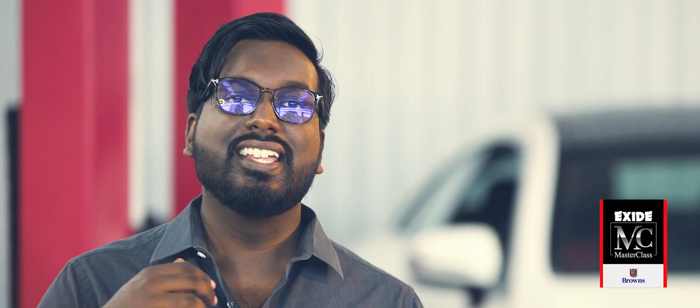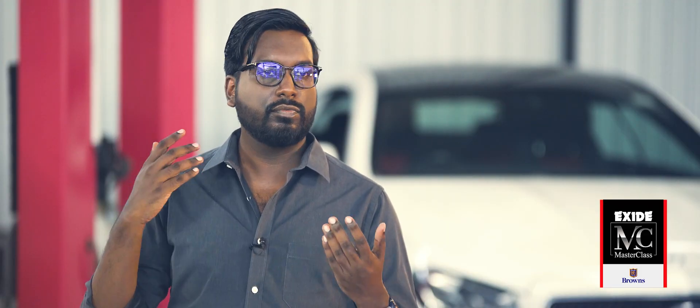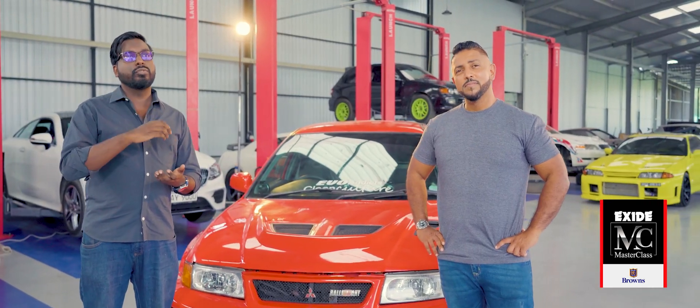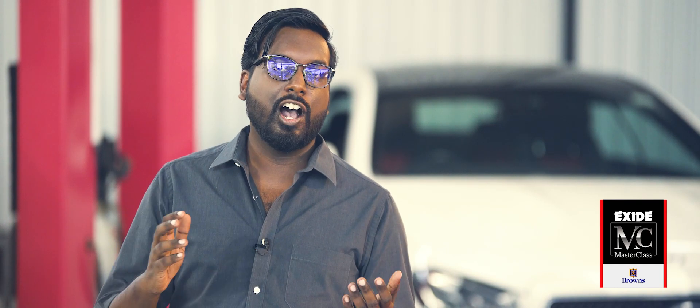There's another reason as well, because sometimes when you get performance cars, they're tuned to a higher standard of fuel — a different type of fuel quality that normally you wouldn't find in Sri Lanka. What that means is you might want to detune these cars just a little bit so that they run consistently on our local petrol.